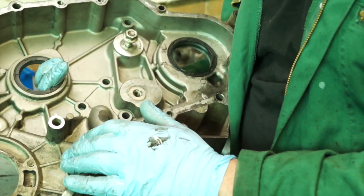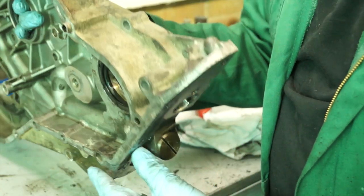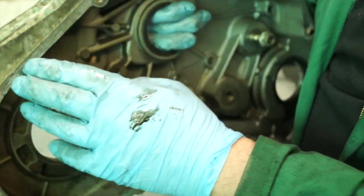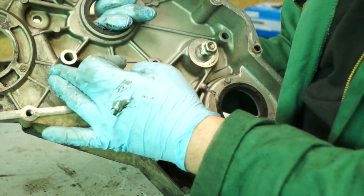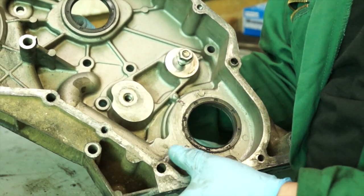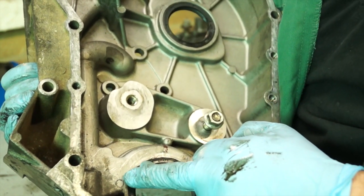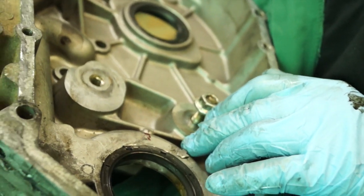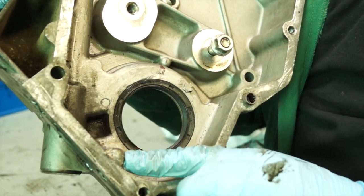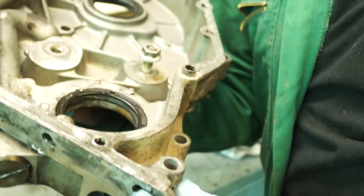The casing can crack — aluminium isn't that versatile, but it is flexible. When checking around the casing, make sure that at the webs there are no cracks whatsoever. A bit of corrosion at the top is not really an issue. It can crack around the web areas, especially where your timing belt idlers are, and also around the crank area — pay particular attention there as this can be where oil leaks from if there's a crack. Also, if somebody has screwed in bolts that are too long, it can crack through and weaken the casing in that area.